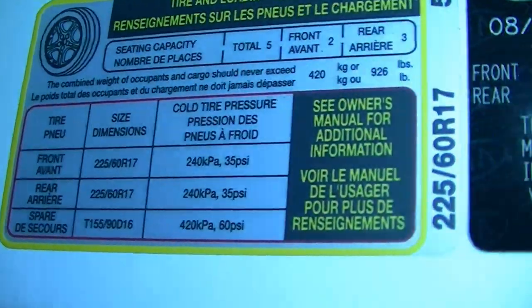While you're doing an oil change yourself, check your tire pressures — the spec is in the door jamb on the driver's side. All that information is right there; the top two are for the car, the bottom one's for the spare. It's either on the door jamb or on the driver's door itself. Also check your washer fluid and all the rest of your fluids. If you have an oil change reminder sticker, make sure you update that too — every 3,000 miles or whatever. That's the end of the video.